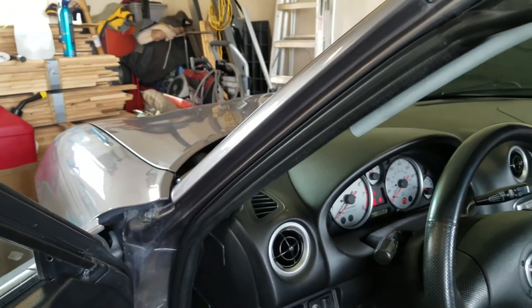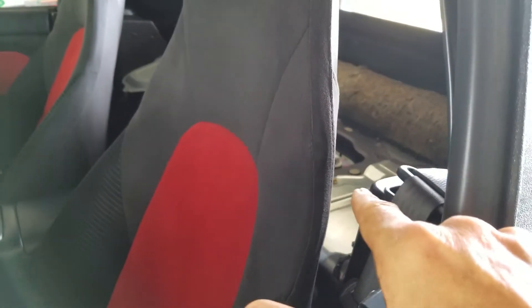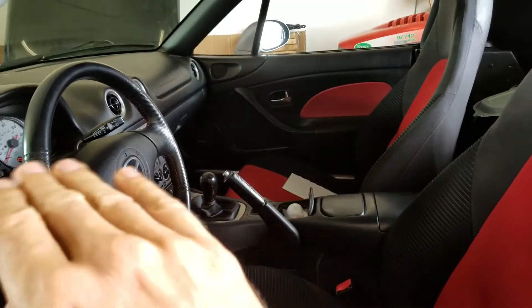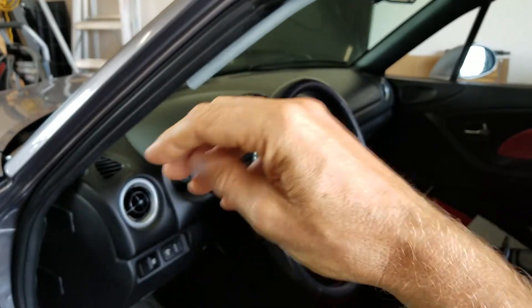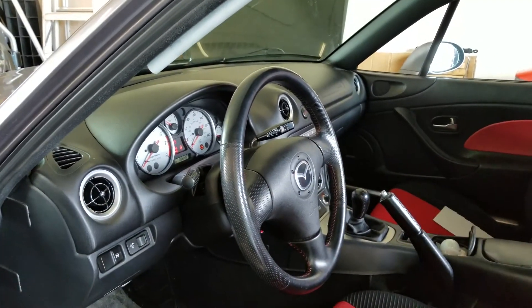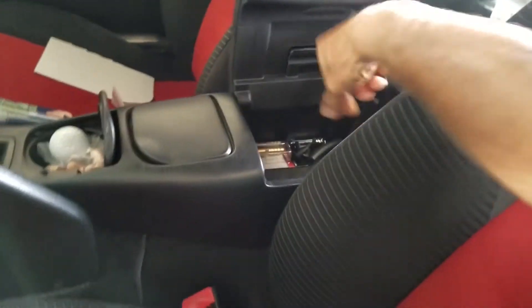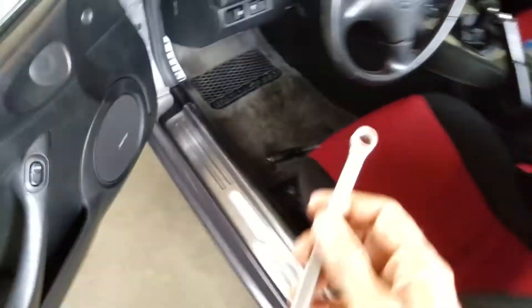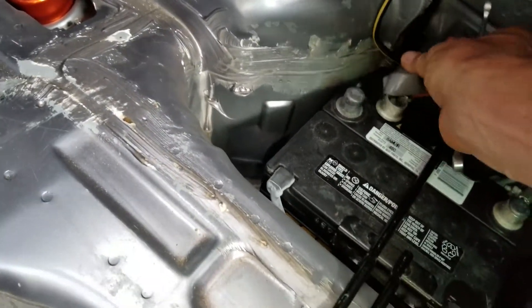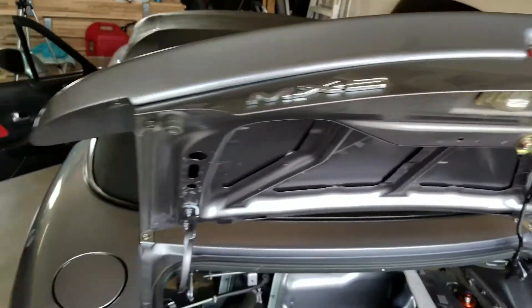The engine died out. Since the fuel pump relay was disconnected, the pump wasn't pumping fuel into the lines, so it depressurized them — whatever remaining pressure was in the lines went through the injectors. Now all the lines are depressurized. Then I used a 10 millimeter to go back and disconnect the battery terminal, so there's no more electricity to anything on the car and you're ready to take out the fuel pump.